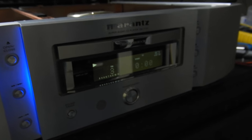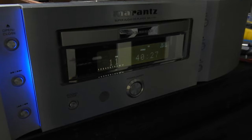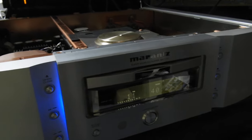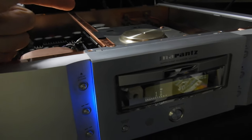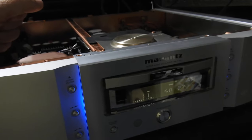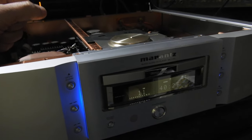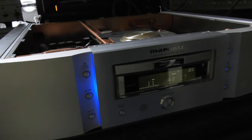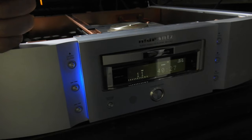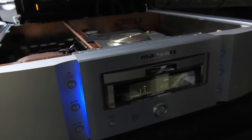The reason I wanted to do a second video is this: the CD playback. As you can see it plays the CD, and if you hit number three it goes there, number five it goes there, number two, number six — the track access is as good as any early Sony or even Philips magnetic drive mechanism. I've hardly ever seen that in a DVD drive. This is a Hitachi HOP-1200W unit, and it is an extremely good thing. It has dethroned the Pioneer P6 that I own and kept because it was a good reader — this is the best CD reader I've seen.